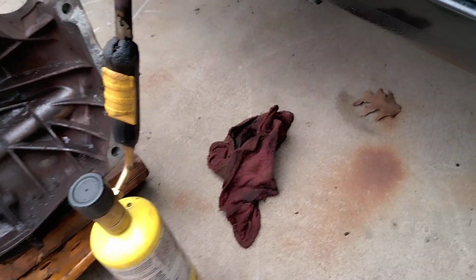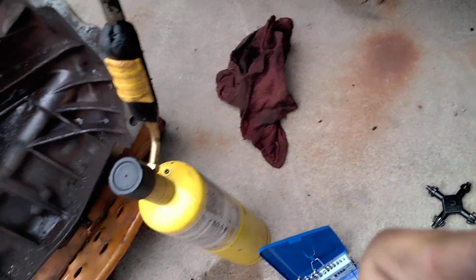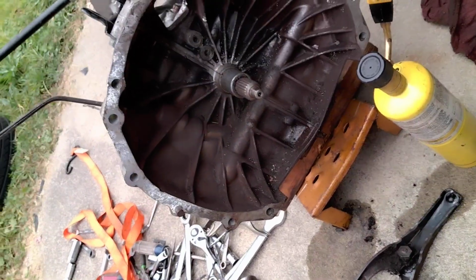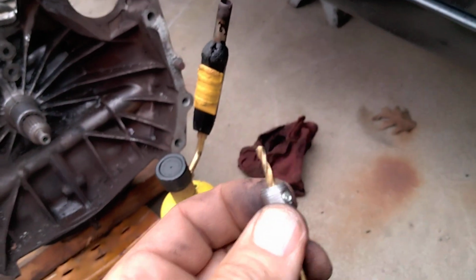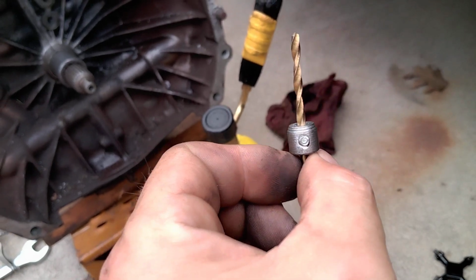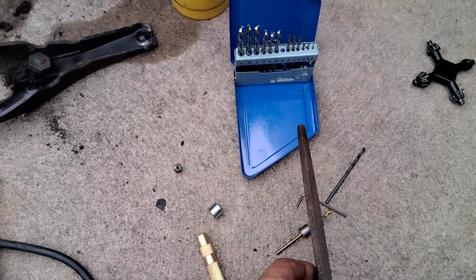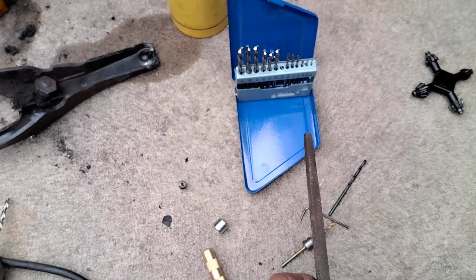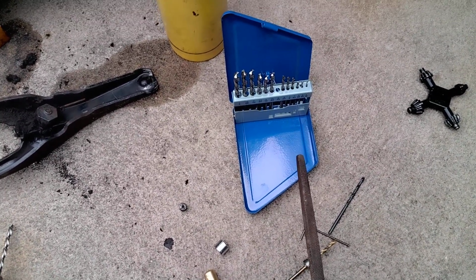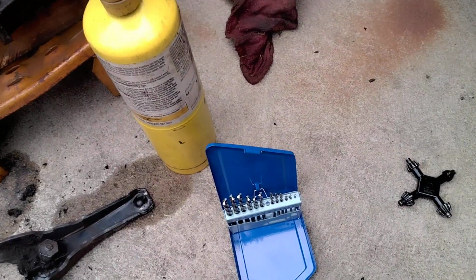And how I got this taper finish on here is actually I put it on a drill bit, kind of like what it's made for. I mounted the drill in a chuck, and I used the set screw to hold it in place. And while the drill was spinning, I used a file. So I just held the file in my hand, the drill spinning, the drill stop spinning on the drill bit, and I used that to form the taper.